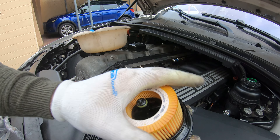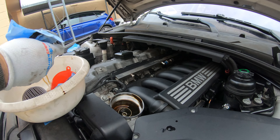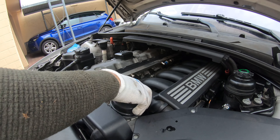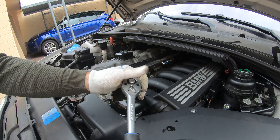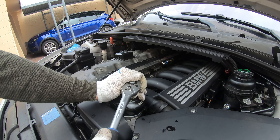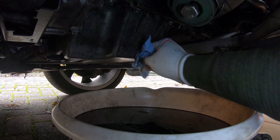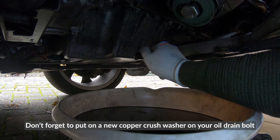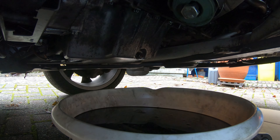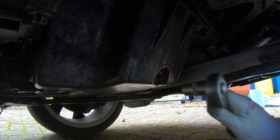So we're going to put this back in. I'm going to clean this out a little bit because there's some oil in there. Just snug this up — it doesn't have to be cranked super hard, just snug so it's tight. I'm going to clean up around here; it's still draining a little bit, but that's okay. Put the drain plug back in and tighten it up. Remember, don't torque it too hard because you can damage the threads — just snug it up.